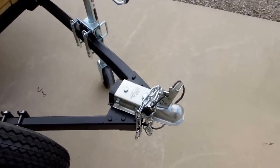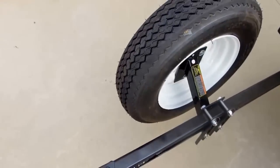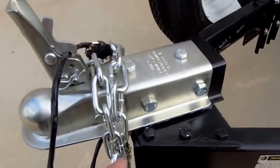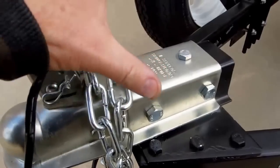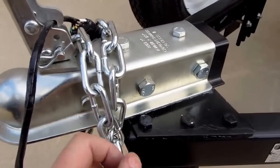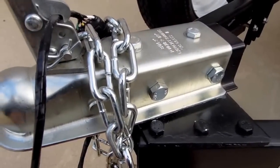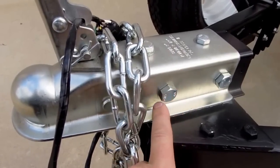I thought I'd point out a few of the specifics that I chose regarding this project. The first is I used stainless steel hardware wherever possible, like you can see here for the trailer spare tire clamp, and also here at the tongue. The bolts that hold the coupler on originally came with just two through bolts — very long bolts that went all the way through. I replaced those with four individual stainless steel bolts that only go through each side, with aircraft nylock nuts on the inside. I felt better about that rather than having the coupler depend on two bolts — now it actually depends on four.